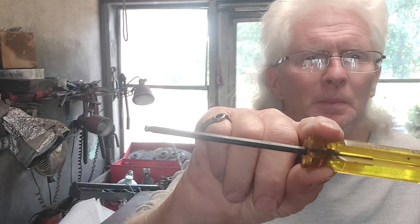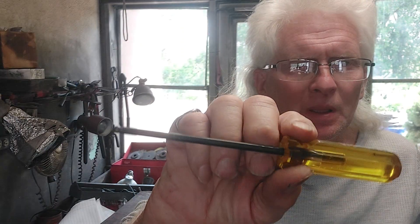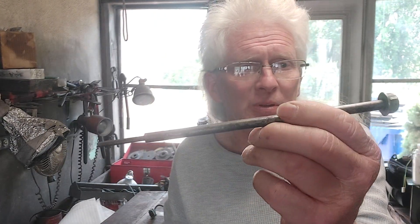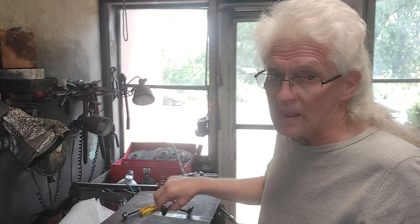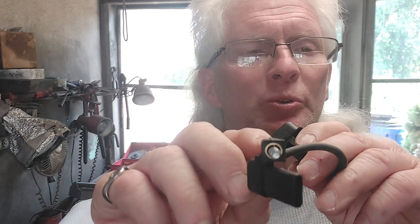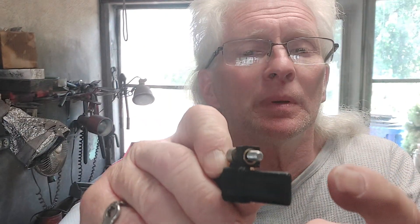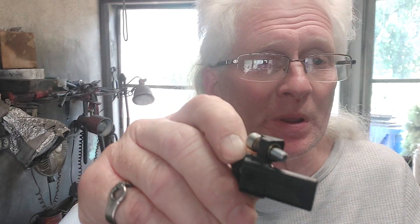I want to bring to your attention the 5/32" ball-end allen wrench. That's what I finished tightening up the bolt with on the sensor into the trans for the flywheel. And this also came in handy - the one that I devised. I faced it up with this. I finally got it in there and got it anchored. The bolt goes to the top, pretty much facing you. The magnetic pickup sensor - this is the OEM one I replaced - fits into a slot.